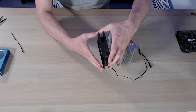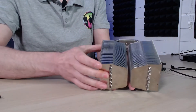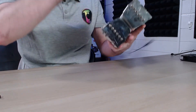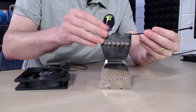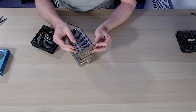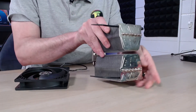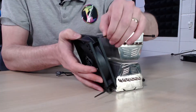For one fan, we need to install it into the side of the cooler blowing through so it goes to the back. If we look at the cooler itself, it comes with two ridges where the fan sits between — that stops it from going side to side. To install this, we feed a cable tie through the back and in between the fin stack so it comes out the other side. Do the same again to the other side, through the fin stack, then install the fan onto the other side, pulling the cable tie through. You want to do this for all four corners.